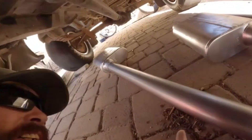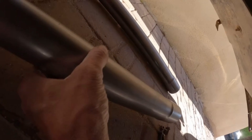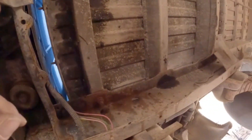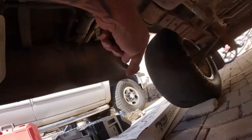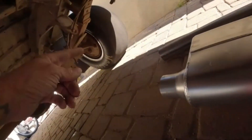Let's go chop it and do another little test fit to see if it goes in. Here's the exhaust — nothing fancy, just some mufflers. We're going two and a half inch pipe on it. We're just gonna go from the headers and we're gonna probably dump right here somewhere. We're just gonna dump right here — one here, one over there — just to get it going so we can drive it down the road.